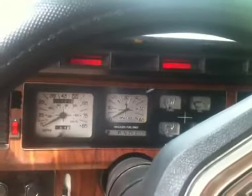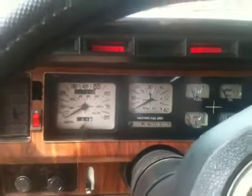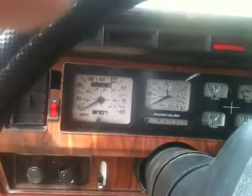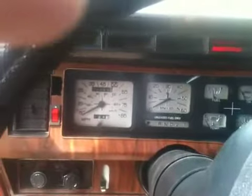Yes, that is new — I'll get an in-depth video of it later on. The brake light comes on; it does have brake problems. I blew out a wheel cylinder in the rear brakes, and now I'll just have the reservoir capped off, so that light will shine from now on.